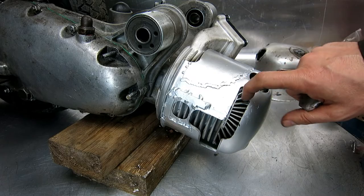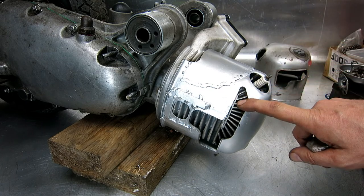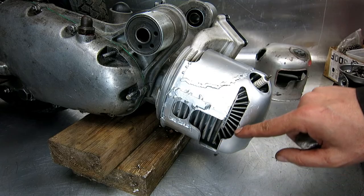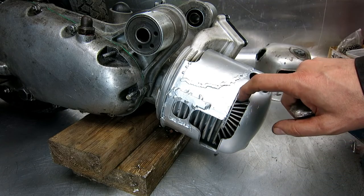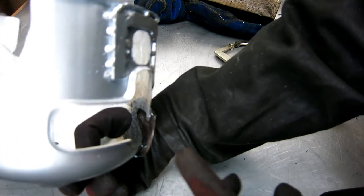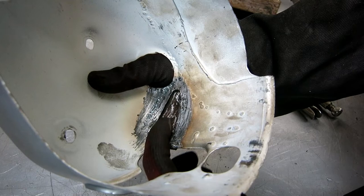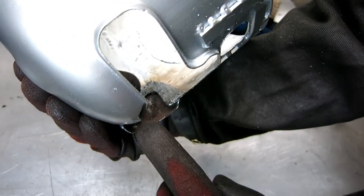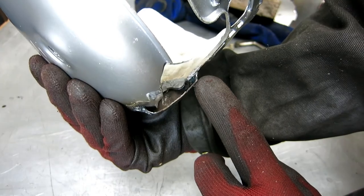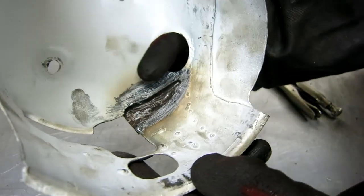Nobody seems to think about what's happening with the airflow through the cowling. If people with radial finned heads are suffering with overheating, then your cowling is going to be a major cause of that problem and you need to be making some modifications to make sure your cooling air can get out once it's warm. I've welded on a section inside there which allows that to vent but then sends the air down and out of that little gap. Hopefully that's going to be tight enough to the cowling that it will still fit with the running board - but you get the gist. The whole point is to let the hot air out.